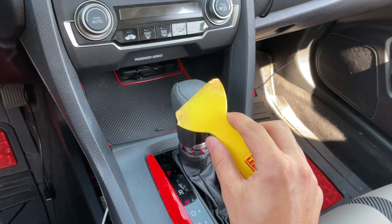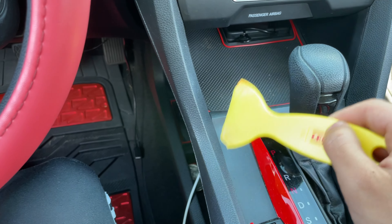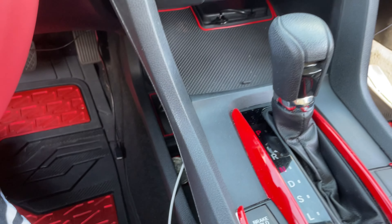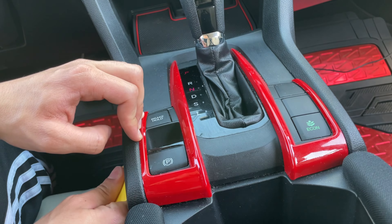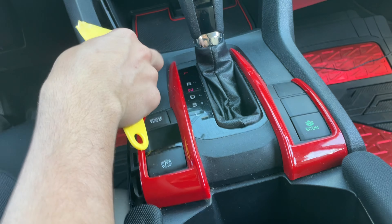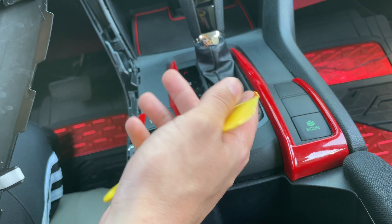The pry tool is about a dollar at AutoZone. If you don't have it you can use a hard plastic card, but I really do recommend it — it makes the job 100% easier, especially with the Honda Civic since the clips are a bit harder to get into. Slide it in between the crease and unclip them one by one. It takes a little effort so don't be scared to pull hard — just wiggle it out. Go ahead and do that on both sides.